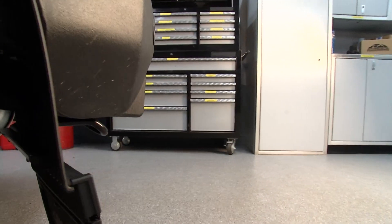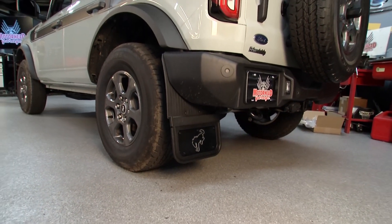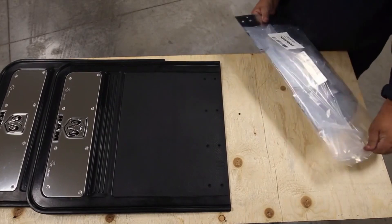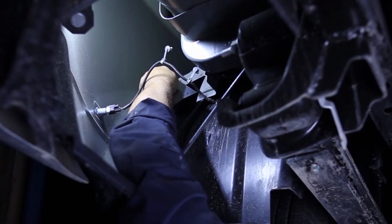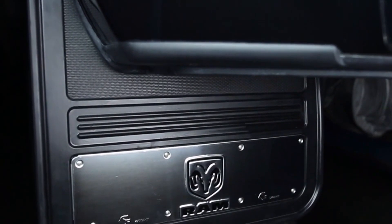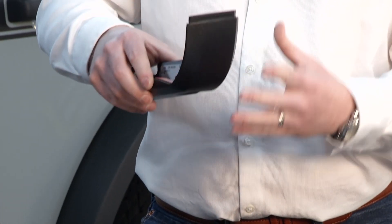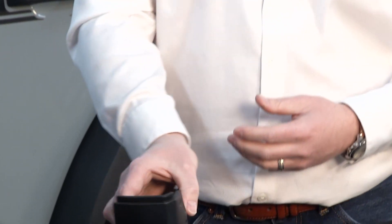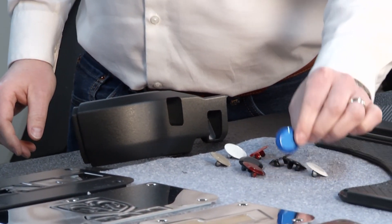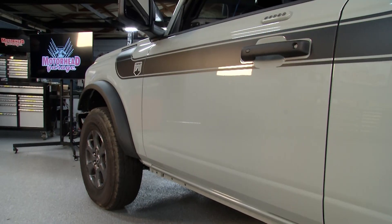You pay so much attention to detail — what kind of things do you consider when designing a mud flap? We want to make sure there is no drilling into the body of the vehicle and no breaking of the paint. To avoid that, we produce heavy-duty hardware and special clips, and we use all stainless steel hardware so nothing rusts — no dissimilar metals. We use aluminum on aluminum-bodied vehicles. We've also had to go to great lengths with newer trucks because of factory plastic pieces that interfere with heavy-duty flap installation. This GMC Sierra is an example: we have a replacement finishing cap — a tapered piece that form-fits to the factory flap — that allows the installation of a heavy-duty mud flap alongside it. For the Chevrolet Silverado, we've had special body-colored plugs made that snap in from the outside to fill the hole on the fender when you install a heavy-duty mud flap.